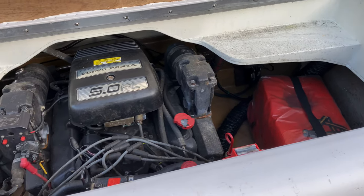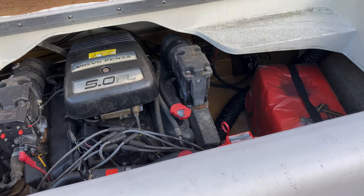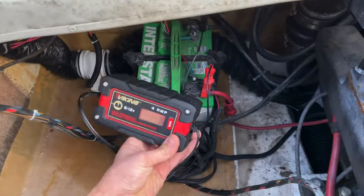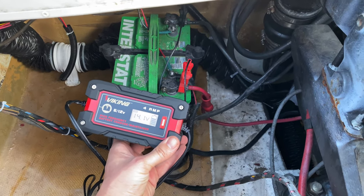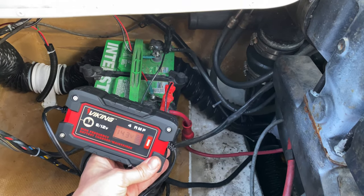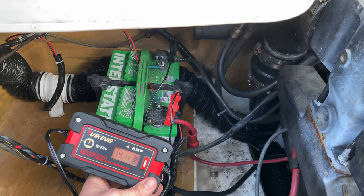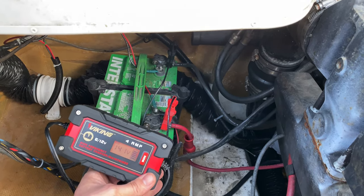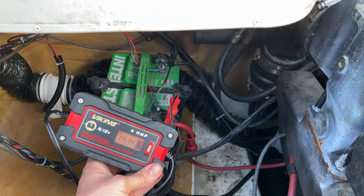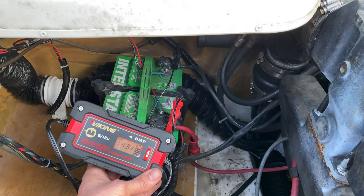Ooh, geez. Okay. Let's get a battery tender on this thing and see what it looks like. All right. Take a look at this. It's a little battery charger. Got this sucker from Harbor Freight. What you want to do, especially before you jump right in the water, take the sucker in, go wakeboarding, the whole nine yards, make sure your battery's good first. This battery, Interstate, you saw it from my prior episodes when we were rebuilding this, held out pretty good. Currently running at 14.3. It's doing a little bit of a charge, but I'd say this sucker's almost good.